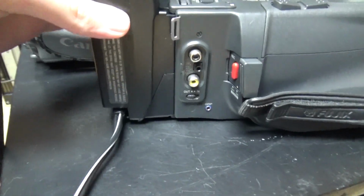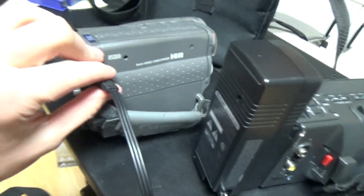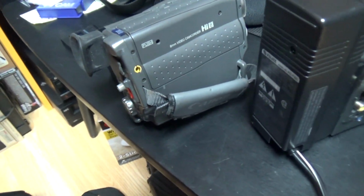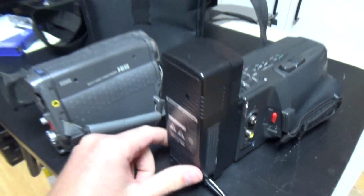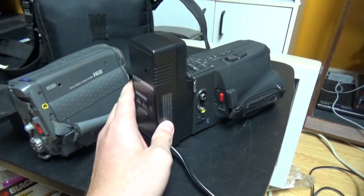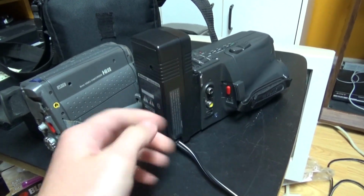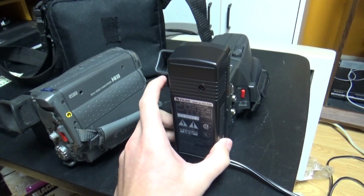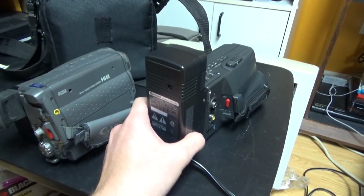And well, this one, something that I like, yeah, it has a regular RCA output, while here it has this thing here. And of course this one does not have S-video because it's not a SVHS. It's not a Hi8 camcorder or SVHS. So it's not like the better version of the tape format, basically. Or a high resolution tape format, just a standard 8, that's what I mean.